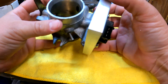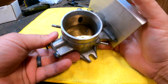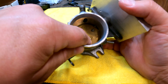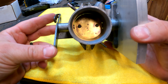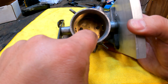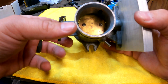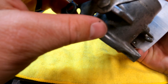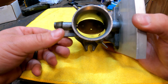We have good action on our throttle blade. A question I don't know the answer to yet: this is the air bleed — I have it all the way closed. There is one air bleed screw in the throttle valve. I am going to be using an idle air controller with a stepper motor controlled by the ECU. I have no idea if I'm going to need to plug these or if it will be enough to just let that thing control additional airflow alongside what I have here. It seems to close fine, and there's a spring that goes on this to make sure it closes all the way.